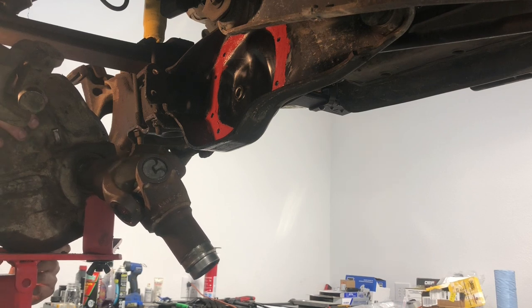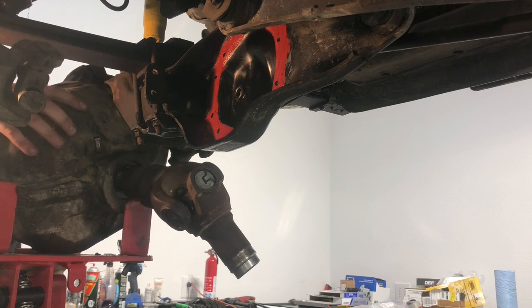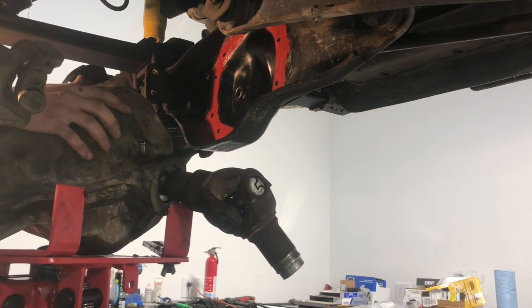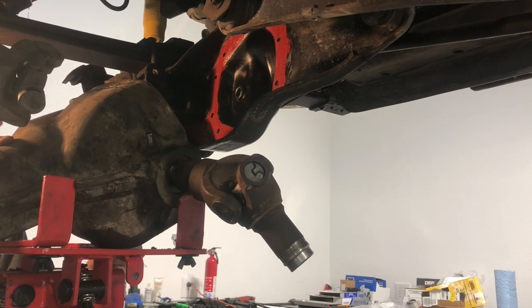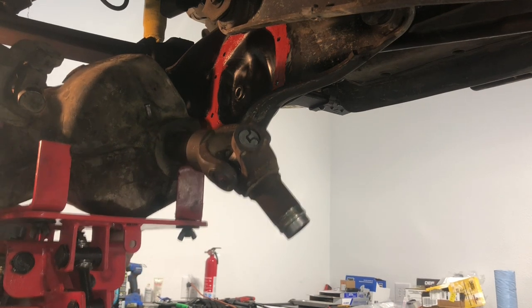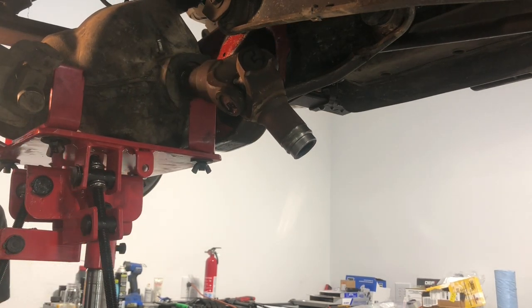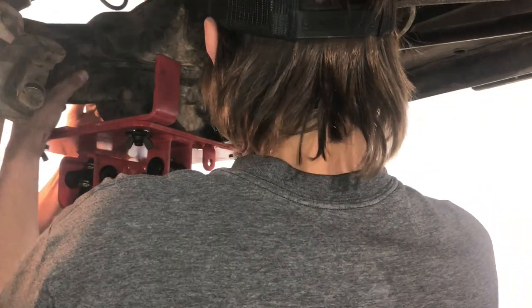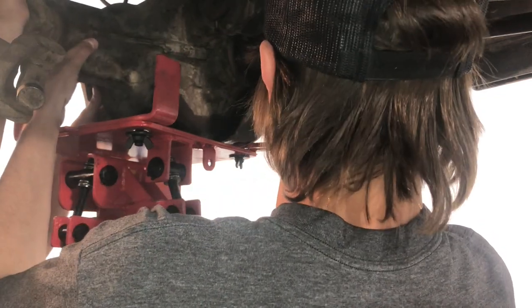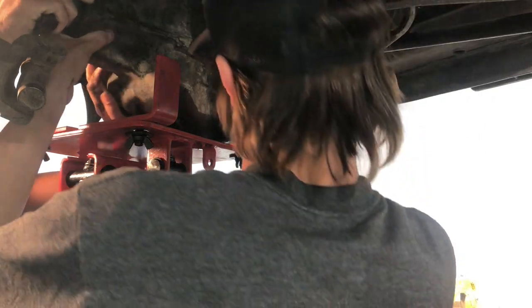I've got the third member back on my jack and I'm raising it back up onto the truck to get ready to install it back into the TTB arm. In the next video I'm going to show the full assembly of this front end and show you more about the U-joints, but make sure that if the U-joint needs to be replaced you do that while you have that stub shaft out — you have to take that little clip off inside the diff to get it off, so you don't want to be doing it under the truck.